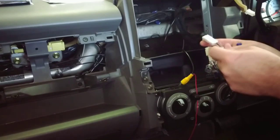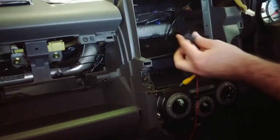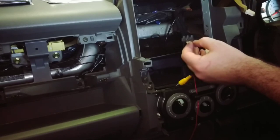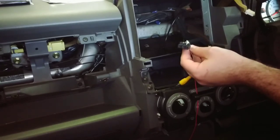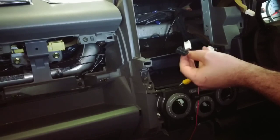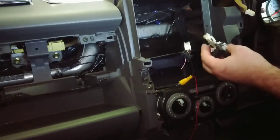This part has wiring to go to the handbrake and a ground wire. That's useful with the handbrake sensor wire — it's pretty standard with stereos like this because they don't want you using all the features like watching a DVD while driving. So once the handbrake is off, it'll actually disable those features. You can get around this by connecting the sensor wire directly to ground — that way it'll constantly think the handbrake is on. I'm not going to get into the legality of it; it's probably not a good idea, but I'll leave that decision up to you.